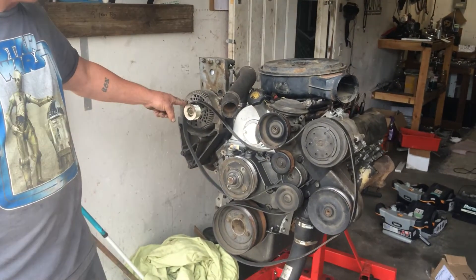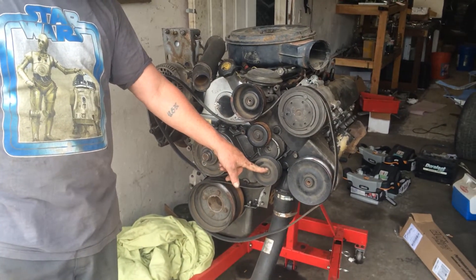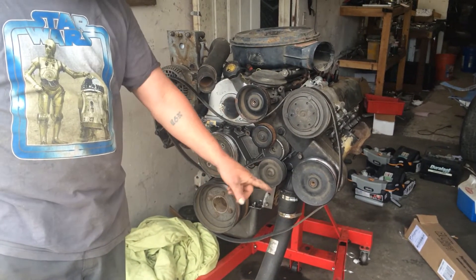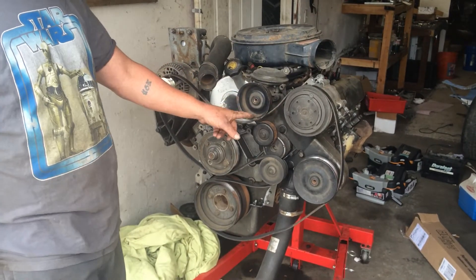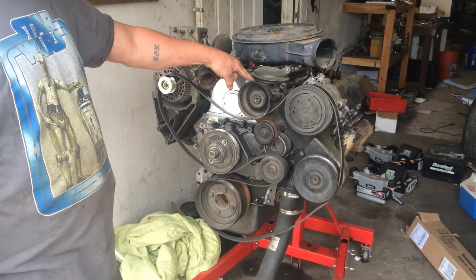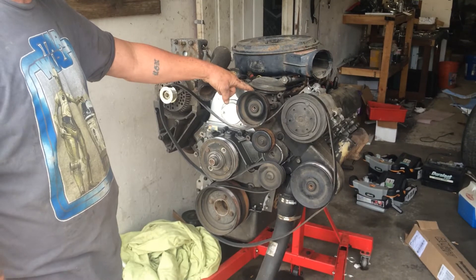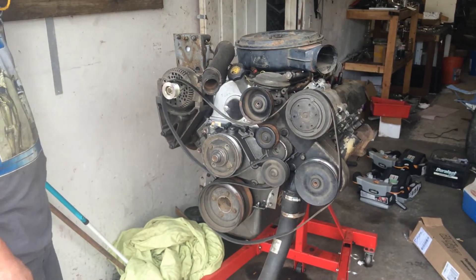As you can see, this is a six-groove belt. Goes under the water pump. Right now I just have it on the idler pulley. Goes around the crank, power steering, air compressor, under the vacuum pump. Sometimes they call it a tensioner or an idler, but on this one it's a vacuum pump, then the alternator.